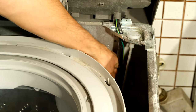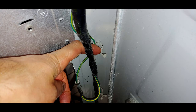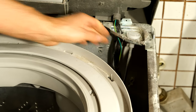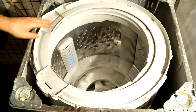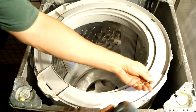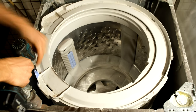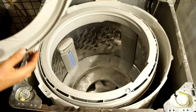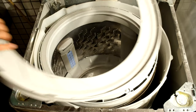If you have a look in there you can see there's a cable management system — I've opened it and there's another one there. That's freed up this wire a little bit. I don't need to take the lid completely off, I just need to shift it upwards. To remove the drum I just need to remove this plastic cover — there's a couple of screws, make sure they don't fall inside. In this case there were eight screws and I'll just take that cover off.